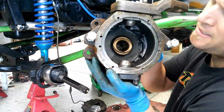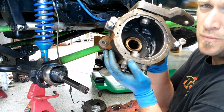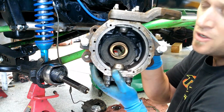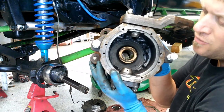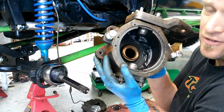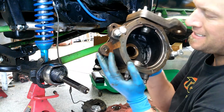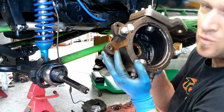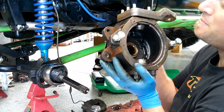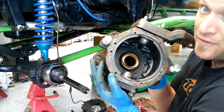The last thing to bring up on the hub is we went to Trail Gear's Trunnion Bearing Eliminator — these pieces right here. They come with new races that you knock into the axle, and then you have these machined metal pieces that match those races, so you don't have a bearing failure. They do recommend you grease these about every 100 miles or so. We have been greasing them faithfully and they have shown zero signs of wear — in fact we've probably over-greased them. We may cut back to maybe 200 miles or once a wheeling trip. We're very happy with the Trunnion Bearing Eliminator for the sole purpose that if your trunnion bearing fails on the trail, it's not an easy trail fix.